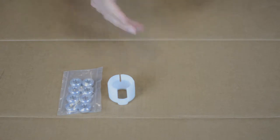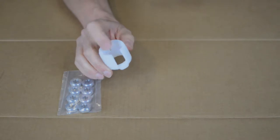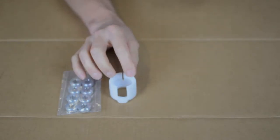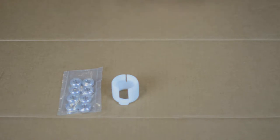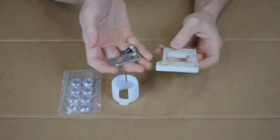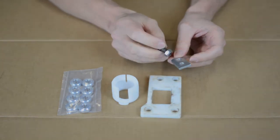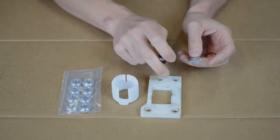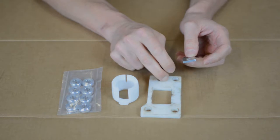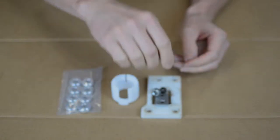New OEM-type shifter cup. There's some interesting ones these days - I think Matrix Garage makes ones with pre-impregnated lubricant, which I think is really fascinating. But this is just a factory plastic one. I also have an old short shifter setup from one of my previous MR2s - it's a really deep drop bracket and then a linkage adjuster. This is actually a mismatch of parts; it's supposed to go with a 93 and up shifter. So I'm not sure if this is going to work, but we're going to give it a shot.